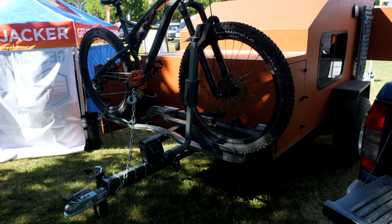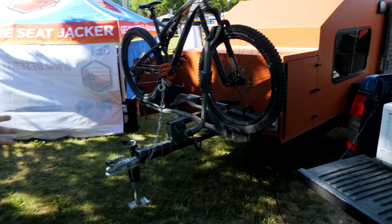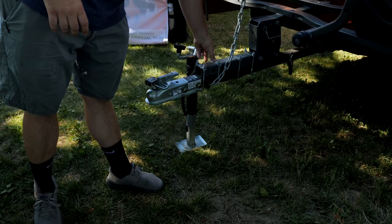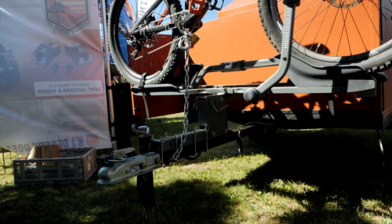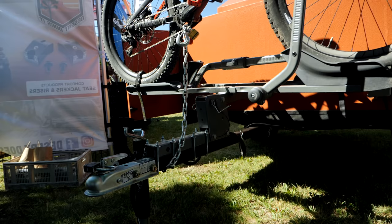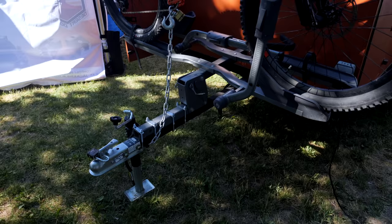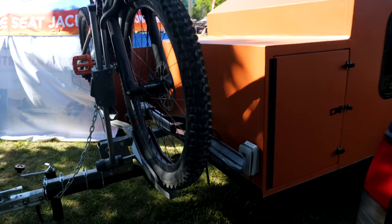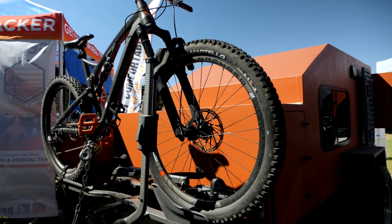We've got a trip coming up and we want to bring the bikes. What I'm thinking I'll do — I've just got this bolted on with U-bolts right now — is weld on a hitch receiver mount right here. When this folds up, I can just slide my bike rack in there and put the pin through it. The bike rack can go on either the truck or the trailer. Obviously you can't use the telescoping tongue with it on there, but when the bike rack is off, the tongue will shorten and lengthen. You could pull it out if you want to put it in a garage and save as much space as possible.